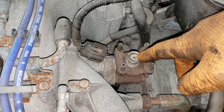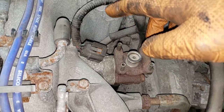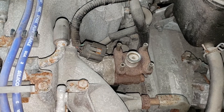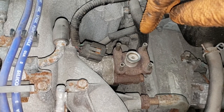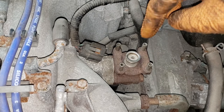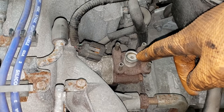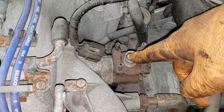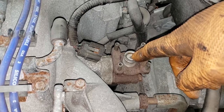The earlier systems were a real pain but these ones are actually relatively easy — all pretty much computer controlled and there's not really much to them. As described by the customer, the issue was a constant misfire at idle, which generally indicates the valve is stuck open. They ended up taking off the motor that actuates the valve, and I should be able to push this down freely but I can't — so that's an indication that our valve is now currently seized in place.